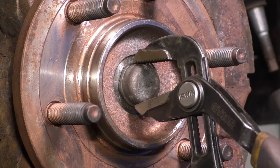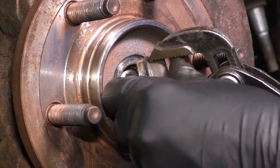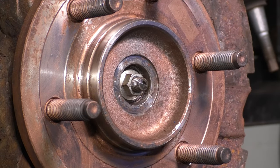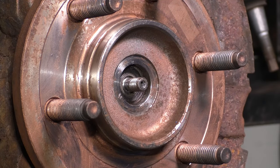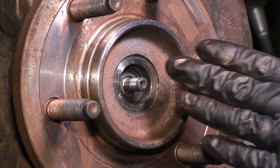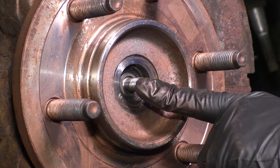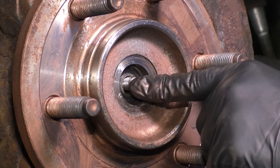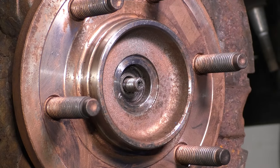Using some pliers, let's remove the axle nut cap. If pliers don't work, it may be seized — you can use a chisel or small screwdriver and tap the top to break it free. Inside you'll see the axle nut, usually a small 13-millimeter. This shouldn't be very tight — take it off and set it aside. Because the inside of the wheel bearing is greased for the four-wheel drive actuator, it's unlikely the axle is seized, but push on the front and pull on the back to confirm it slides through freely. If not, put the nut back on flush with the threads, then use a rubber mallet to tap it free.